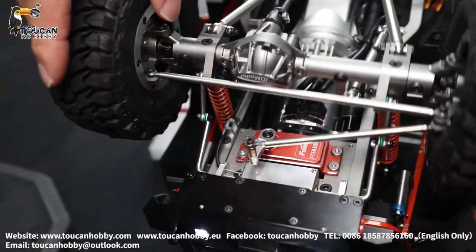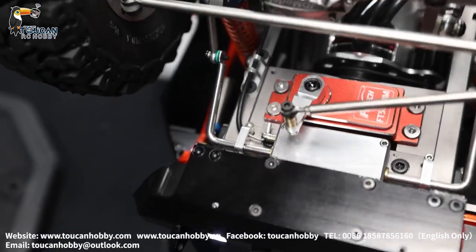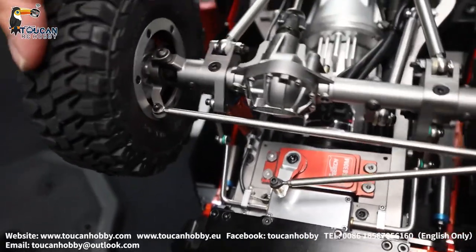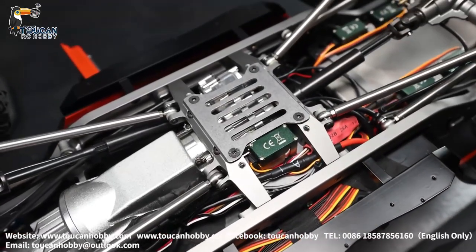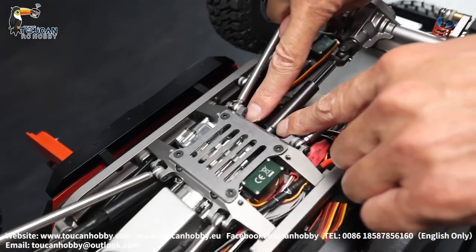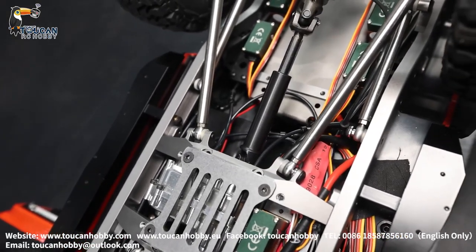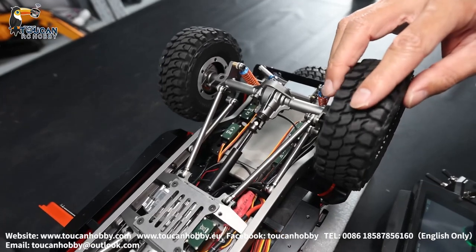Now unlocked — lock it. Pulling out — locked. Now it cannot roll. It goes down together. Unlock it — the rod goes back. Now it can roll again. This servo is for switching to rear driving, front driving, and 4-wheel drive. It is pulling. Here there are two connecting rods from the gearbox. Now it's for driving.